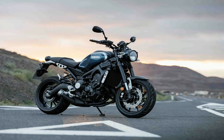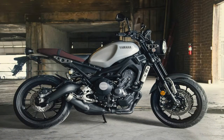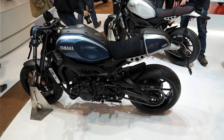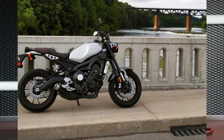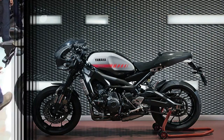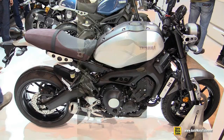A well-exposed aluminum frame forms a sort of stylized trellis skeleton, with the engine as a stressed member to complete the assembly on the XSR900. This futuristic alien look carries right over onto the asymmetrical swingarm that features a split member on the left side to accommodate the drive chain and its guard, and a sharply kinked member on the right. The frame is certainly more ornate than usual, but since it's a naked bike with everything bared to the world, it makes sense to use the standing rigging as part of the overall visual appeal rather than simply a functional component.